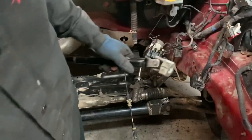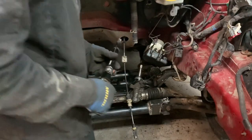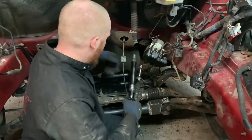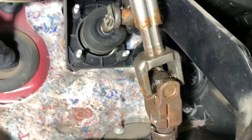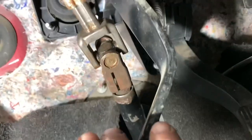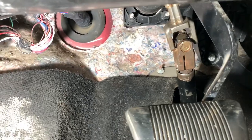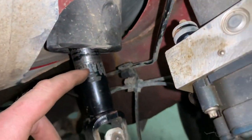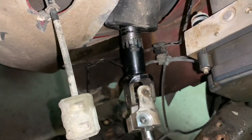This is going to be a three-joint steering shaft now, meaning there's one here, one at the top, then one at the top of the steering column. I'm not sure if that's going to give me any issues — I haven't dealt with something like this before. This side is hooked up, then I went under and hooked up this side. I can see it's pretty much the perfect length. We've got at least an inch, inch and a quarter of slip. It goes down here, the brake pedal avoids it, doesn't hit it. I think I'm going to cut off another half inch or so just to get some more slip up top, just in case of a collision so it doesn't max out the slip yoke.